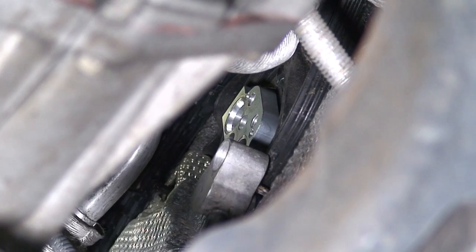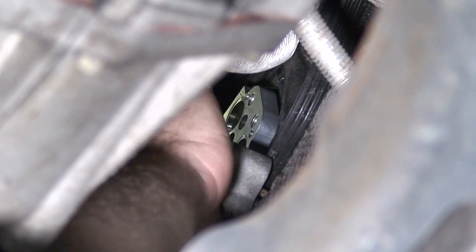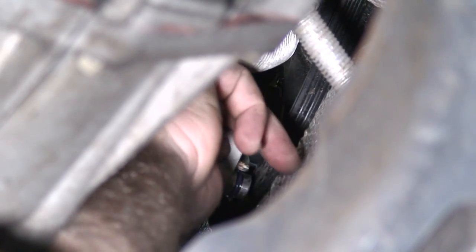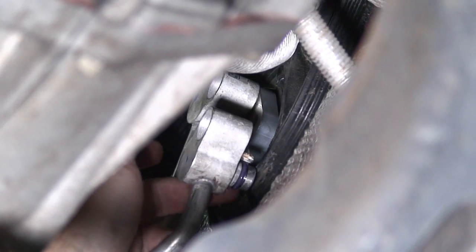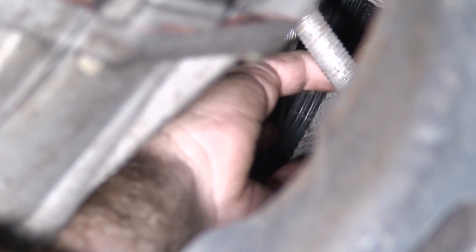Oh, let me peel that bottom O-ring back off. It doesn't look as tight. It does not. Okay, so the top one looks good. We'll go ahead and pop it into place just so we get it sealed up. But this bottom one, not sure I like how loose that is. So when that goes in, that's gonna pinch. I thought for sure I matched it up, but let's take another look at that.